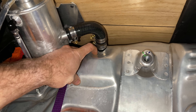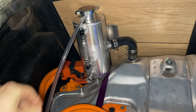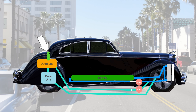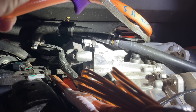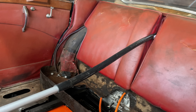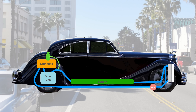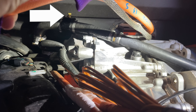I mentioned in my last video that I probably don't need the swirl pot, but upon further consideration I think it might be needed. There is a lot of opportunity for air to be trapped up in the outhouse since it's so high up. I thought about putting a bleed valve in there, but at that point I might as well just put in a whole swirl pot since it is the highest point in the system. There are three local high points in my coolant loops. One is the swirl pot — it's the highest point and the fill point. The second is the radiator, which has a cap with a valve to bleed out air without taking the cap off. The third high point is at the top of the motor, just after the motor oil heat exchanger, where the tube runs back down before going to the radiator. For that one, I'll add a screw-in bleeder valve, unscrew it to bleed out any air that collects there, and once I'm not getting any more air out, I'll screw it down and put some safety wire on it.